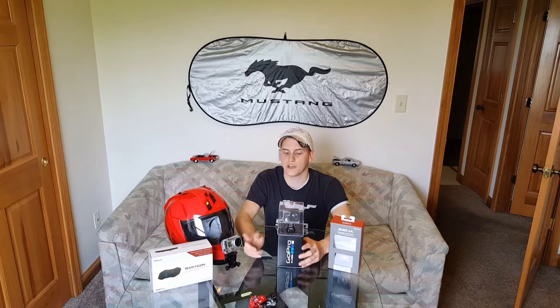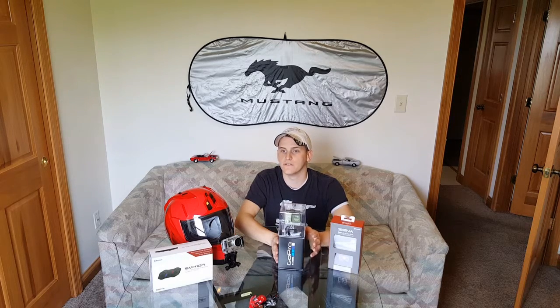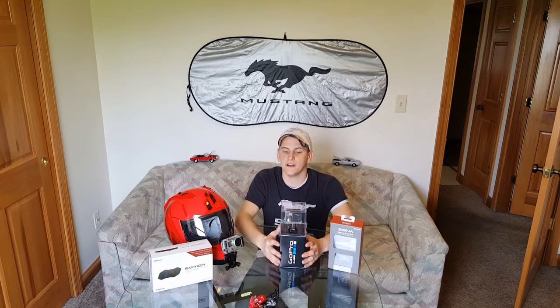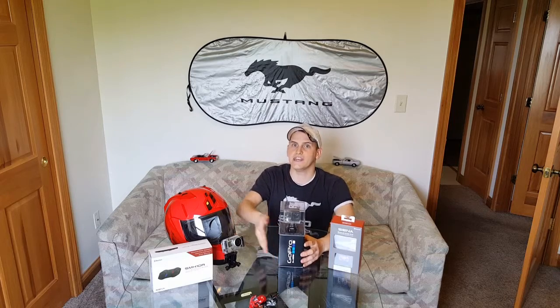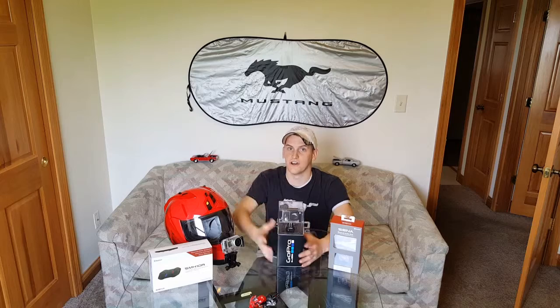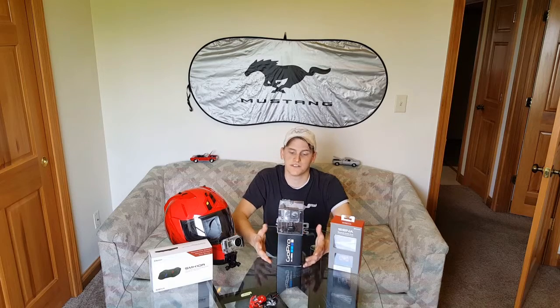I'm not going to be doing a lot of 4K recording, so I didn't really need it. I will recommend that if you go with the GoPro Hero 4, you'll need to get an extreme SD card, because the micro SD card needs to keep up with 1080p recording — you don't want it to jump around or glitch while recording. I bought a 64 gigabyte SanDisk Extreme with 90 MB/s read and 95 MB/s write speed. They run about $100, but it's worth it — no lagging in your videos.